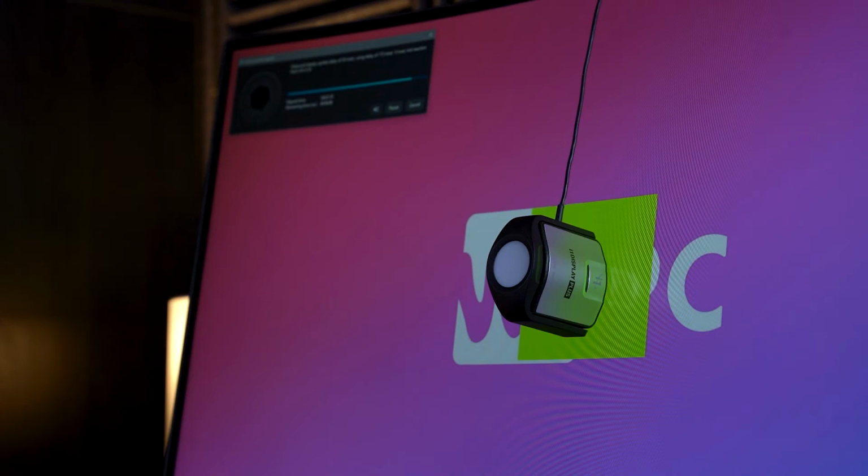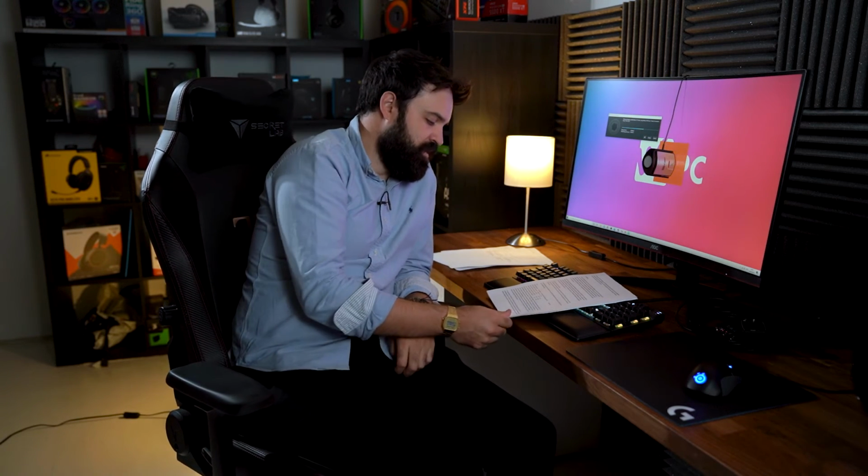That's where the instrument looks at how accurate the colours are to true. For the purposes of this test, we tested warm, sRGB and user. Warm was the out-of-the-box settings. The results were pretty good actually. I was impressed just because most monitors out of the box aren't as good as these figures. Changing it to sRGB was actually better, but you are limited in terms of the brightness you can use and some of the other presets that we talked about in the OSD section.